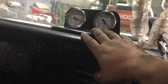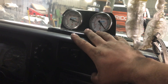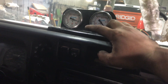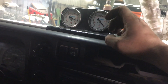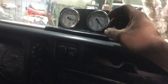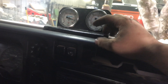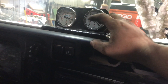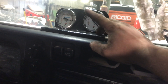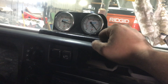In my Toyota I've seen it all the way up to 20 to 1 because that thing has some issues I need to fix. And then on the low end — anything less than 2 to 1, you want to tighten the char bed back up. There are two ways to do that: you can put in smaller wood, which will make small charcoal and kind of clog things up, or you can add in straight charcoal and that'll help too. And if you mix wood with charcoal, then you get rocket fuel — thanks to my buddy Bob for that one. I use it in the Toyota all the time; it warms the truck up quicker and makes better power.